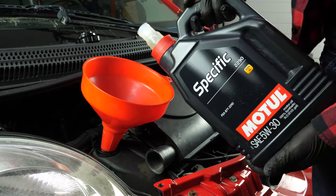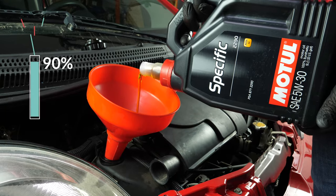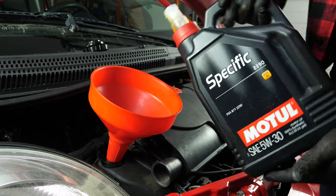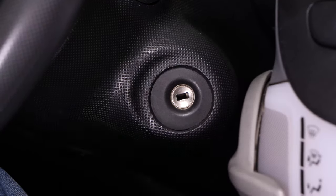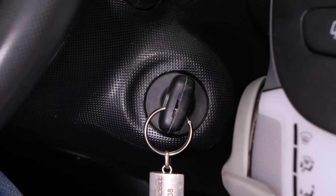Now, add the oil into the engine. Begin by putting in 90% of the suggested amount. This will leave you a large enough margin to adjust the level of oil appropriately. You can find the exact amount of oil suggested for your car in the description of the tutorial. Close the oil fill plug, start the engine, and let the car run for 30 seconds. This will fill the oil filter.